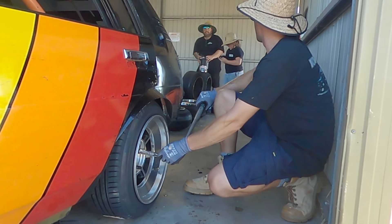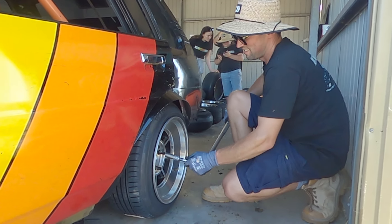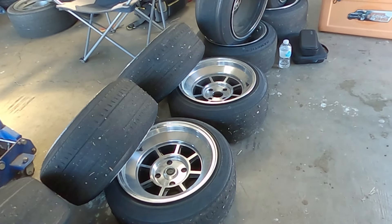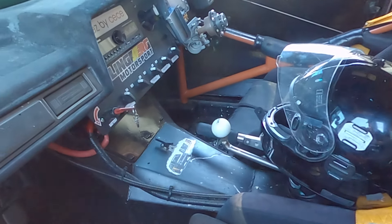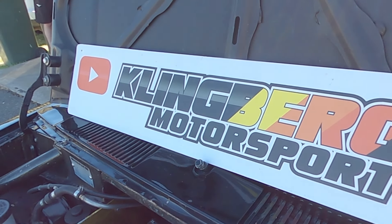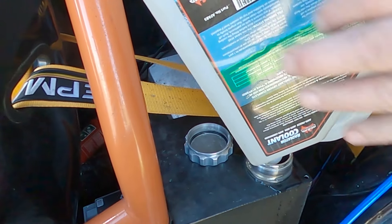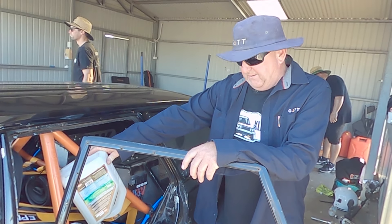How many tyres have you guys been through? 11 and 12 sets. She's been smashing tyres all day. About 1 to 3 laps per set. He's still running 15s though? Yeah, that's the go — 15s on the Corolla. Nice big trans tunnel to take that J motor. Jared's just recently started his own YouTube too, so definitely go check that out. Just chucking some water in for the squirters. On the back wheels and on the radiator. So this just plumbs a bit of water into the back wheel and squirts it into the radiator as well to keep it a bit cooler.